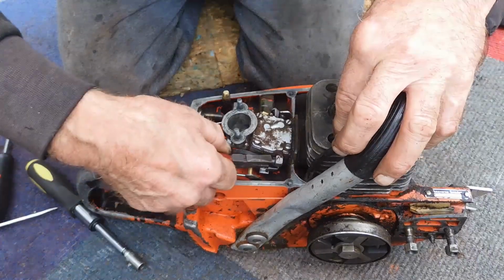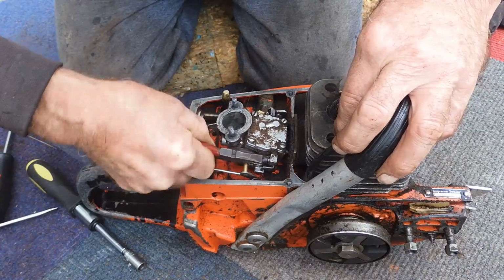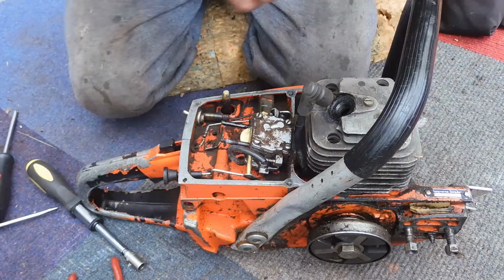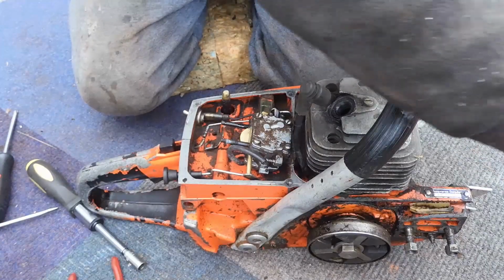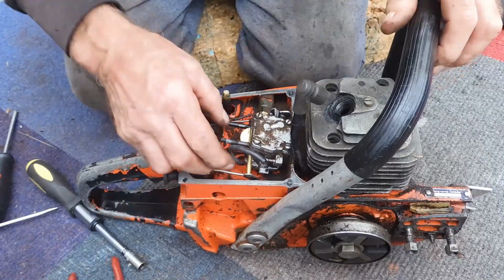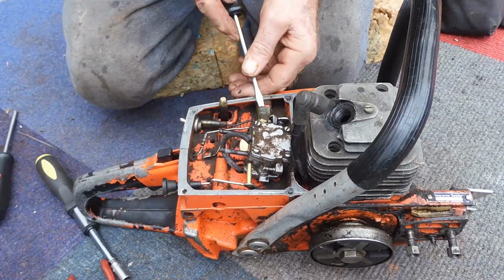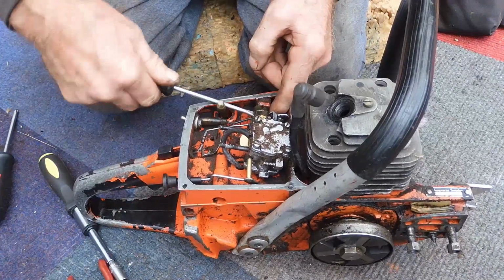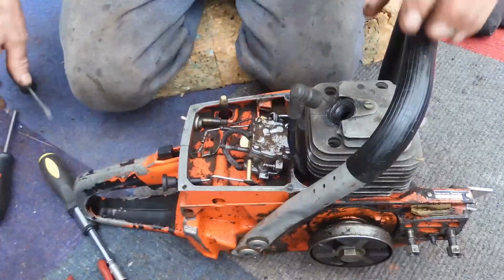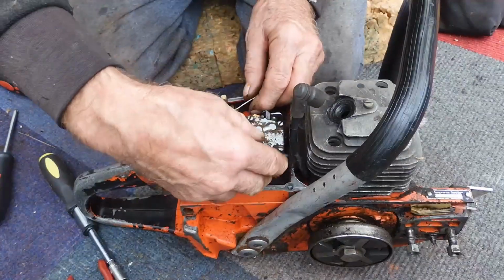And if we can just undo this, it'll be welded on. Normally, when you look at it, they're bloody soft and rotten. It's this ethanol in the fuel. And normally you find if they're stood around, the filter inside the fuel tank, gas tank, if you're overseas, get the little plastic guide thing off. The fuel tank filter is normally just rotted off.